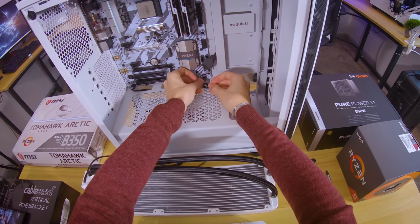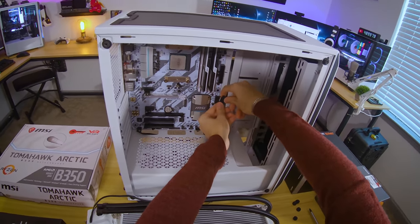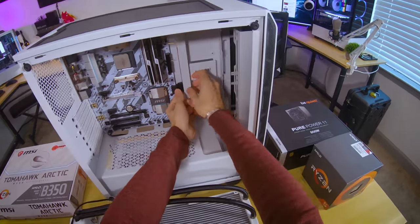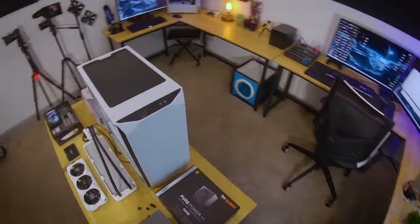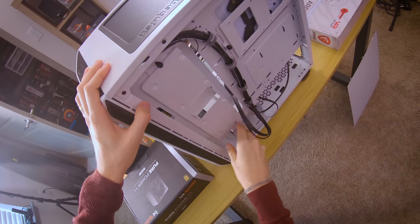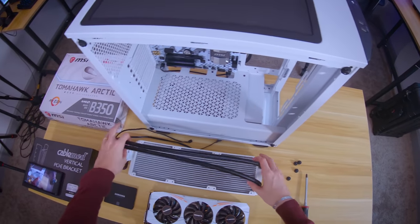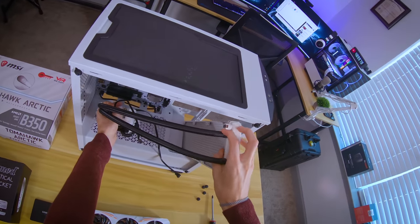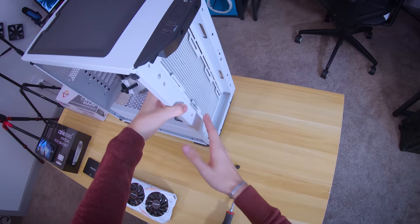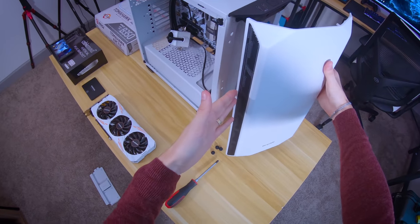Positive on the left — tuck that in. What I really like about this board is we've got a 90-degree USB 3 connector for a cleaner look. Here's a cool feature of the Pure Base 500: we can remove this thumb screw and the entire bracket just falls out. I've already shifted the hard drive cage a bit further toward the back. The AIO radiator is going to sit here with fans on this side — not ideal since the air has to turn 90 degrees from the side vents, but we've got enough rad space that heat really shouldn't be a problem with a 65-watt chip.